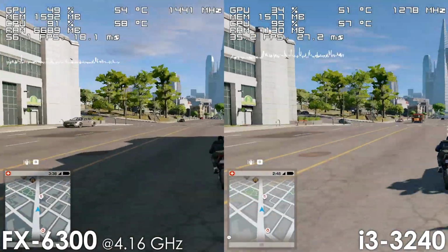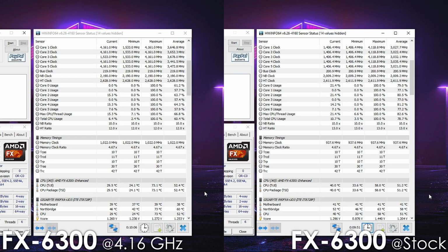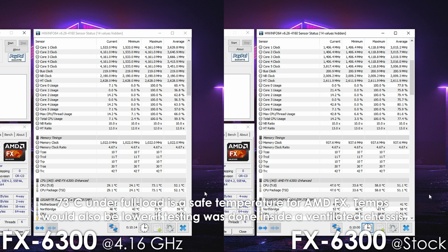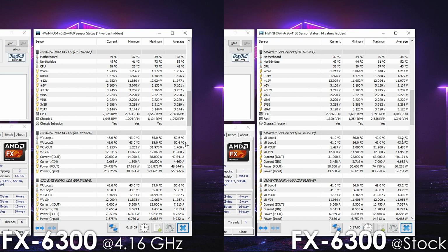at least when driving. You're probably now thinking, okay, well, overclocking increases power consumption and temps, and you'd be right, but since we're not really pushing things to their limits, it's not that big of an issue. Sure, the increase in CPU and VRM temps isn't small, and even though we don't want to be going any higher with our CPU temperature, the VRM temps are still very safe, and don't forget that this is what we're getting using Intel Burn Test.